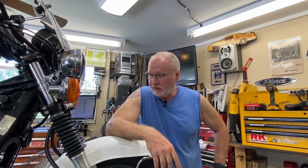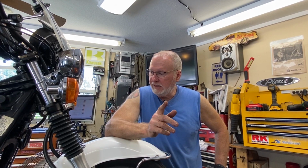But I'm kind of glad I did all that stuff, because I never really changed out the throttle shaft seals. I had taken the throttle shafts out because they were stuck, gummed up. So it was fun putting the seals in, and it was fun doing the work on the choke, or the enricher plungers. And I can't remember if I mentioned it before, the reason why I had those out as well this morning was the emulsion tubes. I'm sorry, I've been breathing exhaust in here. I can't think. But I will put the gentleman's name, the viewer's name, right about here, who said about the emulsion tube stuff, because he brought up a really good point. I hadn't thought of that.